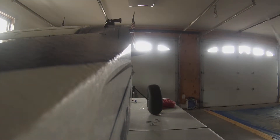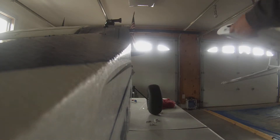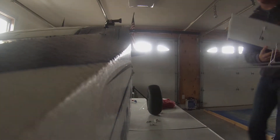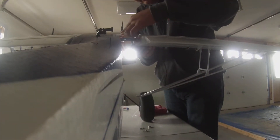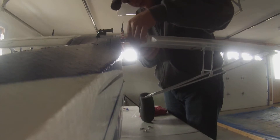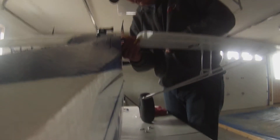Now let's grab the other wing. This one's got a little more dihedral in it because a friend hit it with a basketball. You want to pull your leads out just a little bit — not a tremendous amount. Go ahead and line the spar up with the wing hole, use a bit of a twisting motion. Connect the ailerons and flaps leads, and tuck the excess wire inside.